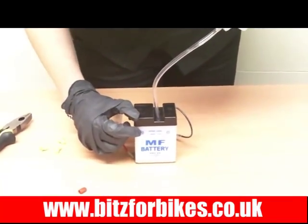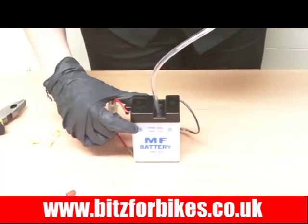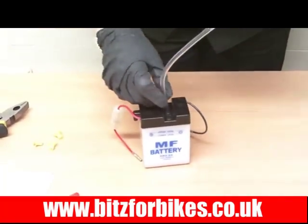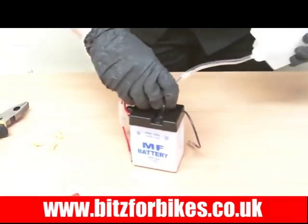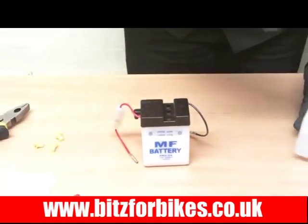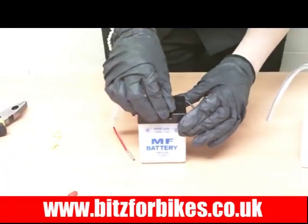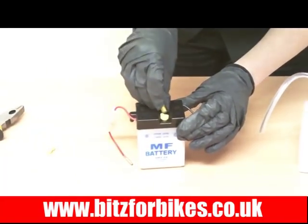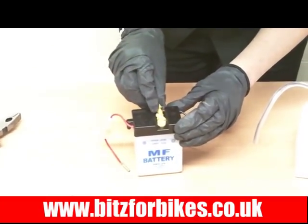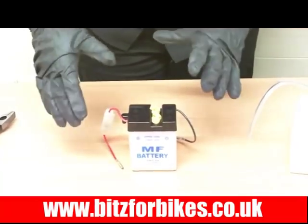On the front of your battery it will show an upper and lower level. The ideal place for your acid is at the upper level. Once you've reached the top, simply take it out and continue to fill the remaining cells. Once you've done this, place the little yellow caps that you removed before just on top — don't push them in, just rest them on top. Sometimes the acid can fizz up a little bit and this will stop any damage to your surfaces if the acid does overflow.